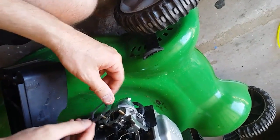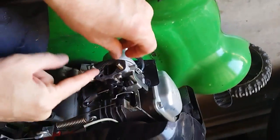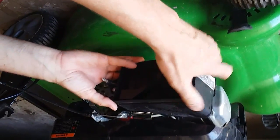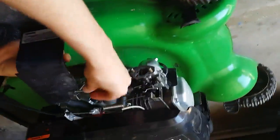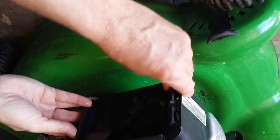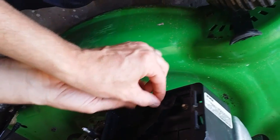In our kit we got two different ones. This one covers the holes, so you need to use the other one. Align it so it doesn't cover the holes — see, that's wrong. Flip it over that way; it leaves all the holes open. Then the carb is still loose here. You put your air filter holder on top, and don't forget — you've got to put your spacer back on here. The all-important spacer. That should line up with the first hole here, and then you've got to find your two holes down here to put the air filter back on. This also has spacers — that's really just to protect the plastic. Pushed it out, so I'm just going to push it back down.